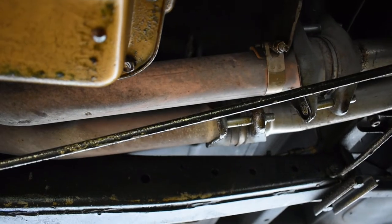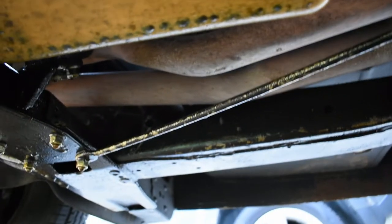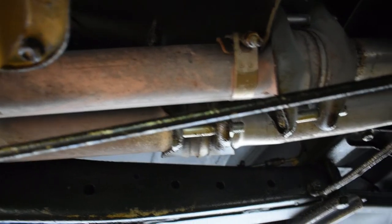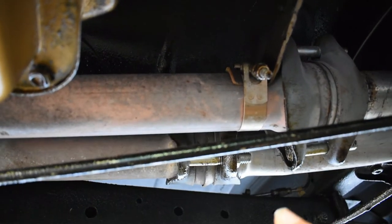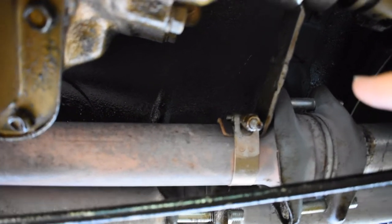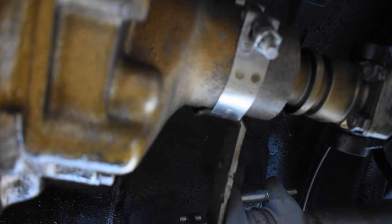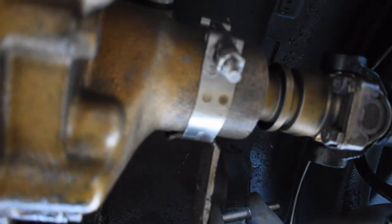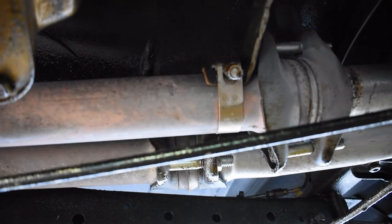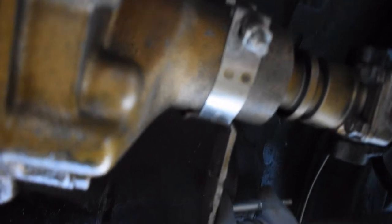I'll move back to the back of the car and give you another shot of this. You can see here we've flattened out. We're next to the transmission fluid pan now, and you can see where they were on top of each other up at the front and then came down and flattened out. The first mounts are here along with these joints. They're actually strapped together at the collector, and then strapped to the spline neck at the end of the transmission, close to the U-joints. This has worked really well — they don't shake or rattle.